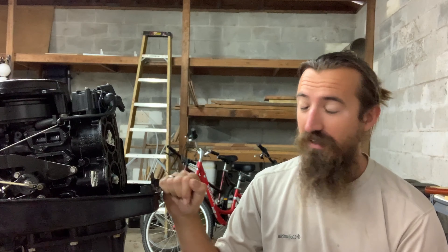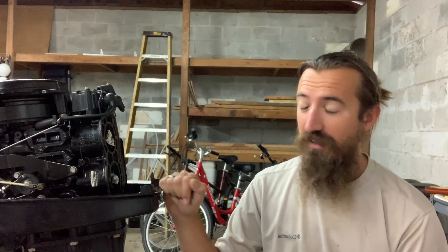The kicker is this one down here in the corner. It's looking like I'm going to have to remove the head to get to this bolt and drill it out, because I don't have any room due to the bottom cowl. There are six bolts underneath that hold the power head on. At this point, anytime I take this motor more apart, there's a chance more of it is going to break.